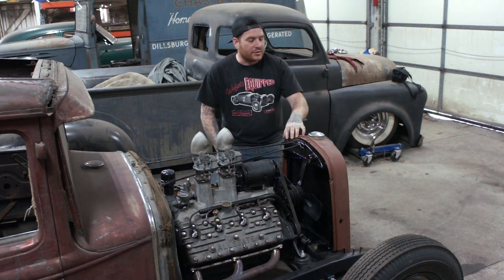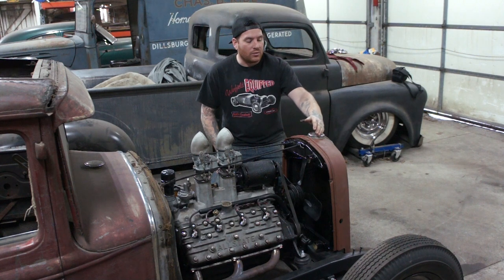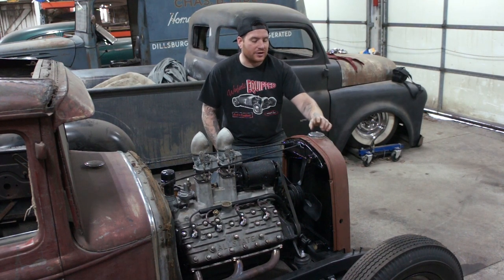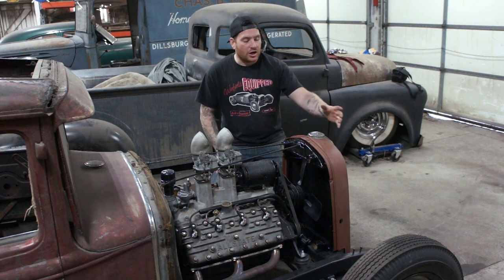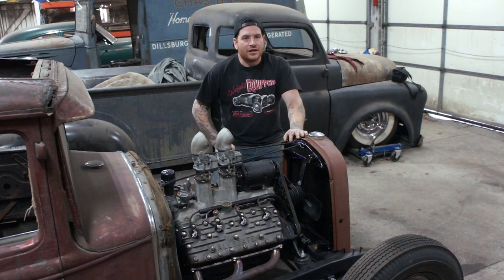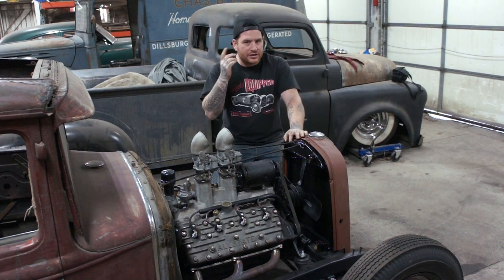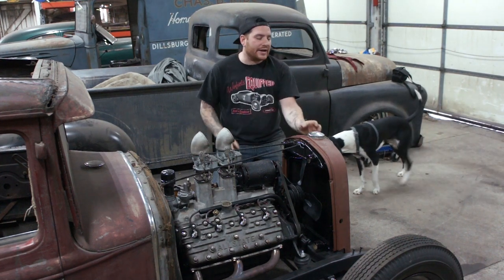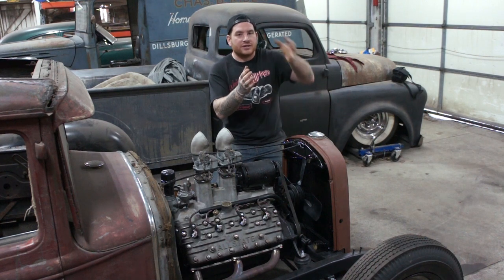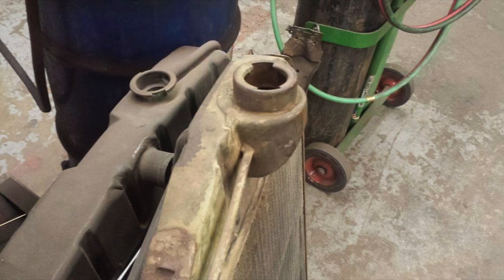What that creates is the next problem: the water neck, if you want to use an original cap, does not line up. Your water outlet ends up being about halfway in the hole and you have a big open spot about half the size of the opening that the grille is forward of. So on the top here, I used Chris from Dick's Radiator in Pottstown, Pennsylvania — really good with these old radiators. He and I brainstormed together and he actually thought of it because he had a bunch of radiators kicking around his shop. He remembered one that had the water outlet on a 30s radiator that was a soldered-on piece going to the front of the radiator, putting the cap and the fill to the front of the neck. So he dug around and we found it.